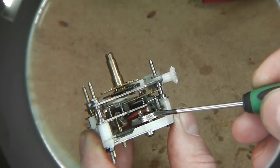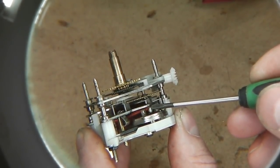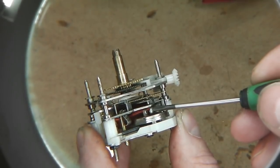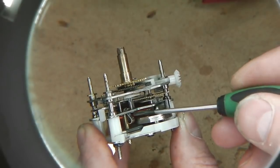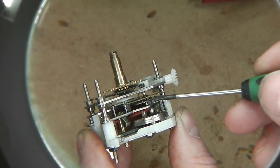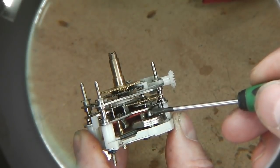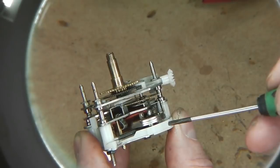So as that unwinds, these set of contacts come closer and closer together, and as it touches this side, the coil energizes, pushes against it, and throws it back. It reaches the end of its stroke there, but this inertia carries on going on this flywheel and manages to push further back into the clock mechanism, and then creates a loading on the spring, which gives you the tick-tock, and away you go until it runs out of energy again, rejoins this contact, and then throws it back, and that's what makes that lovely clicking sound.